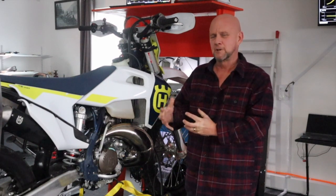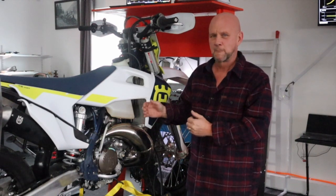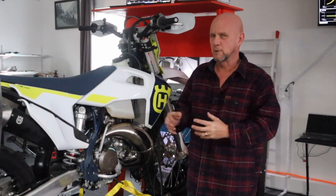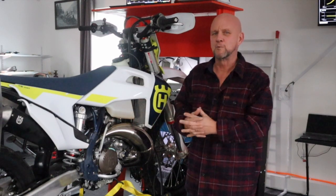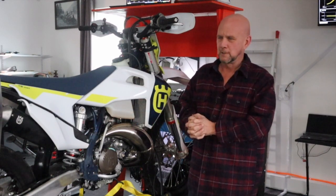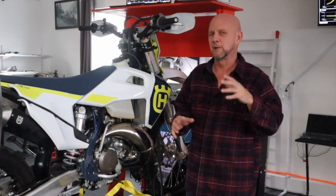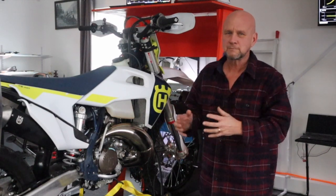It's good to know what gear it's actually running in, and it's also important to know what the actual air/fuel ratio is. I think that's so important — you can really lean things up and gain some top end, but you wouldn't be able to ride it that way on the track; it would be way too lean. A lot of times you might make a power shift but it might be really lean or rich. With the air/fuel ratio you can go, 'I could fix this and get it back.'